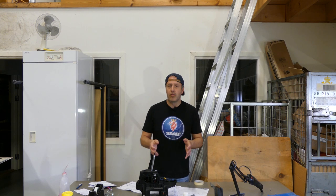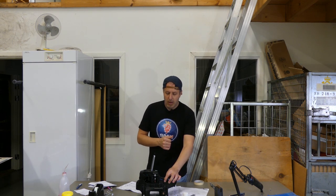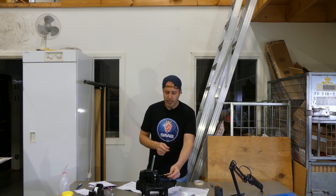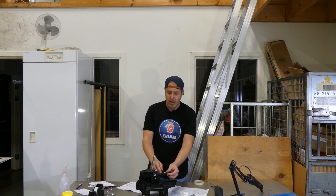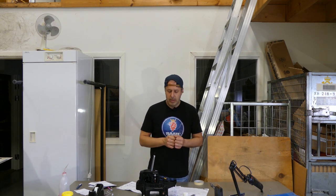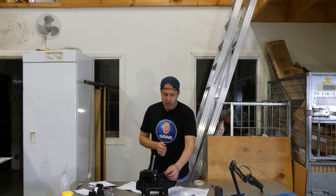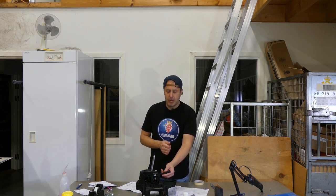And that's basically because you have information in the TCM, which is the transmission control module, and it's located in the engine bay, and there is also an enclosure with some kind of switch in it that knows where the selection is. So there is a wire connected to this, which goes back and forth, changing the selection in the gear shift selector in the engine bay. So between P, neutral, reverse, and so on. So the transmission control module knows that it's in P, but the body control module doesn't know it's in P when you have a defective switch.